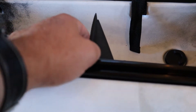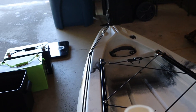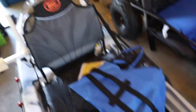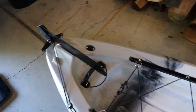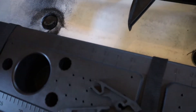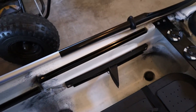The only drawback is I'm taller, so my personal adjustment would put the pegs about right here. But once I put them up there, it doesn't leave me any room to adjust the rudder with my foot. So I had to compromise and put them about halfway back. Now if I drop the rudder down using the little pull cord, I can use the foot pedal to swing the rudder one way, and if I pull the other one, it swings the rudder back the opposite way — which is how a rudder is supposed to work. The support from Brooklyn Kayak was helpful once they got back to me. Still not a hundred percent thrilled with the foot pedal design — I think they should have a secondary pedal above the main footrest that allows you to adjust the rudder.